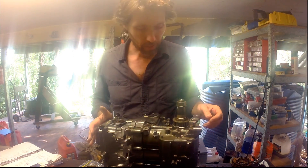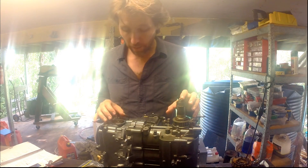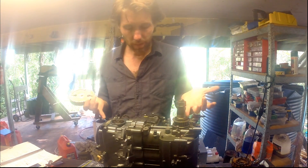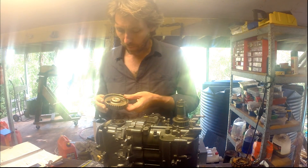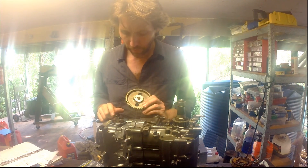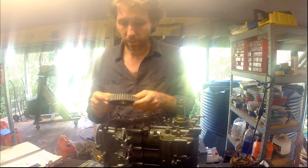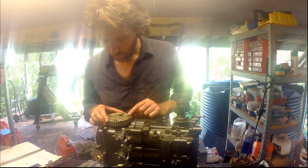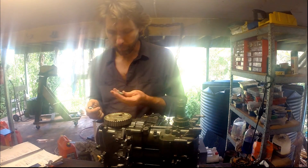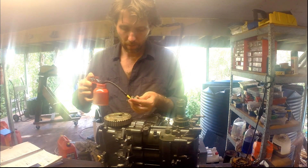Now we've got this head on, I'm going to push on and complete the installation of the driven sprocket for the camshaft and the timing belt. That way we've re-synchronised the crankshaft and the camshaft and we're back in action. There's a dowel here — this one does come out so just be careful of that. On the bottom of this driven sprocket for the camshaft there's a hole that goes in, so we'll pop that down and lock it in position. Then there's just a washer and a single bolt, and I'll put a little bit of oil on it.